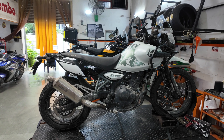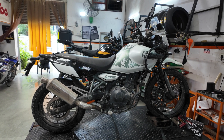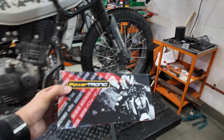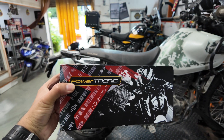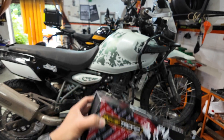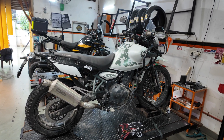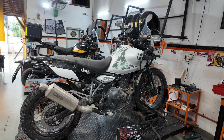This bike has a Wayto Speed aftermarket air filter. It also has a FuelX Pro Plus, which runs on the richest setting, map number 10. Race Dynamics have sent me a Powertronic unit for this motorcycle. So today we are going to install this. We have already dyno tested this particular Powertronic unit on this motorcycle with this exhaust, the FuelX Pro Plus and the air filter. And we are getting a little over 5 horsepower at the rear wheel — 5.1.